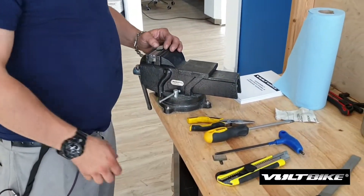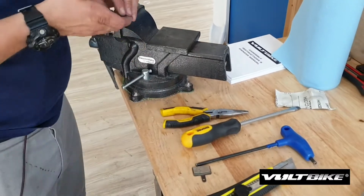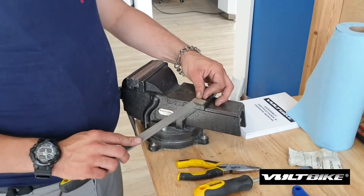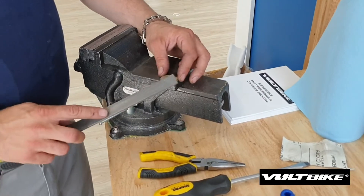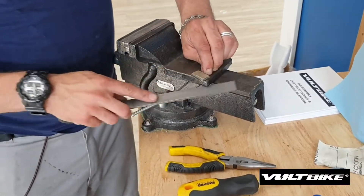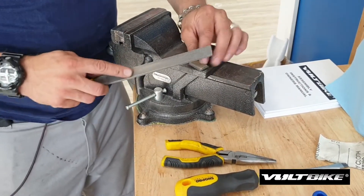We have a pretty easy fix for that. In order to do this you're obviously going to need your pads — clean, non-contaminated ones — and a file. Very simply, once the pads are out, the very bottom edge is what's known as the leading edge; that means the first point of contact with the rotor. You're basically just going to want to take that edge and make it an angle over 45 degrees, so take your file and see just how easy that resin material comes off.